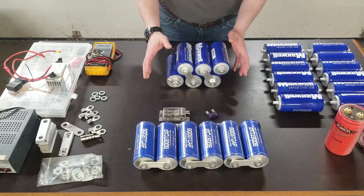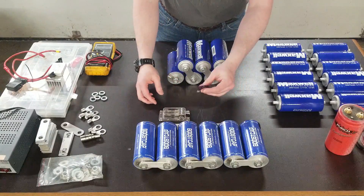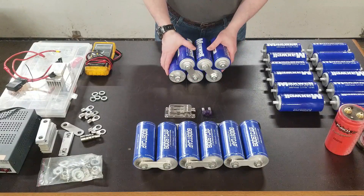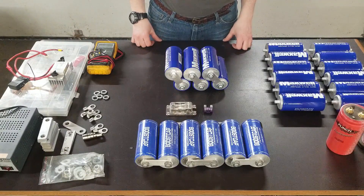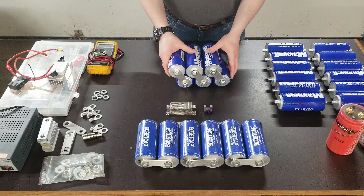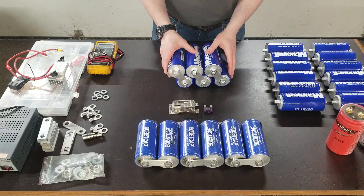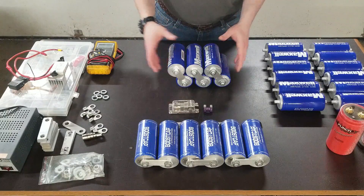So: bus bars, ring terminals, lock washer, nut — maxi fuses are my preferred method, but you have to fuse these. They're treated just like a battery, but unlike a battery they can discharge very quickly and have a lot more exposed contact area. Building a small enclosure makes sense. Once installed, these need zero access — an installer could simply put them behind an amplifier rack. The maxi fuse does need to be accessible at all times. Always disconnect your capacitor bank before disconnecting your battery at the front of the vehicle, and before getting your vehicle serviced.